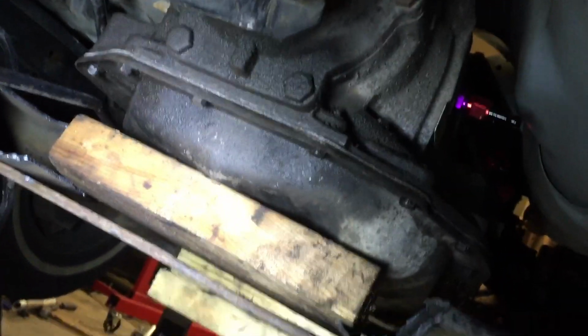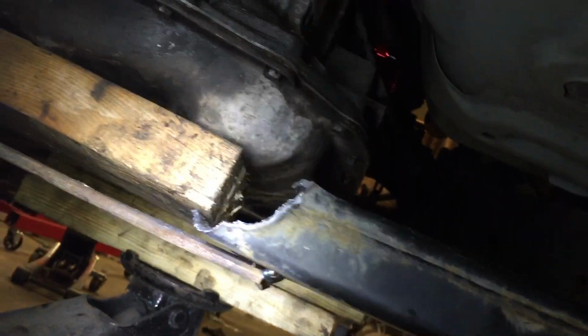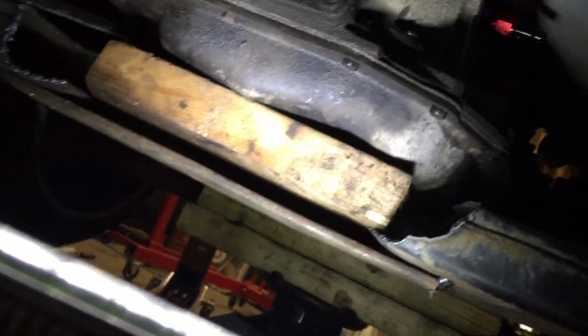And then this cross member went super high, so what I ended up doing was I welded this plate to the bottom and ended up having the plasma cut nearly the entirety of the top of the thing off. So then my mount's broken, so I'll get a good 80E mount and I'll build some offshoot mess from this thing to hold the trans up. But right now the jack isn't holding it. It's just this wooden block here up against the piece I welded in.